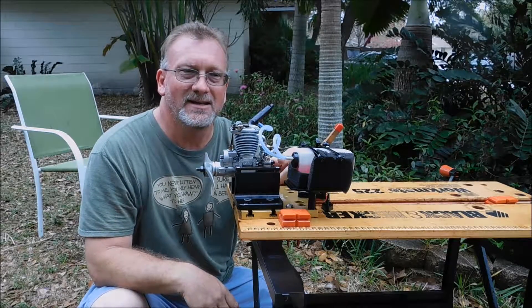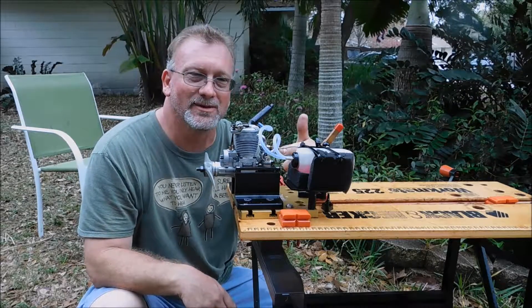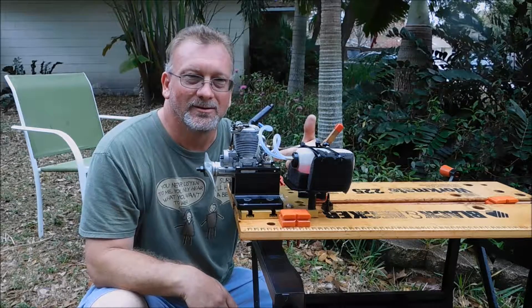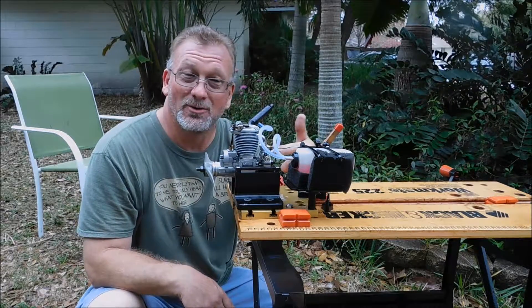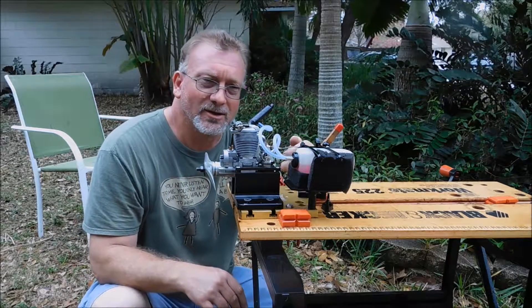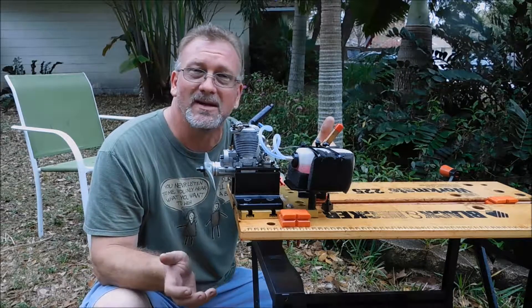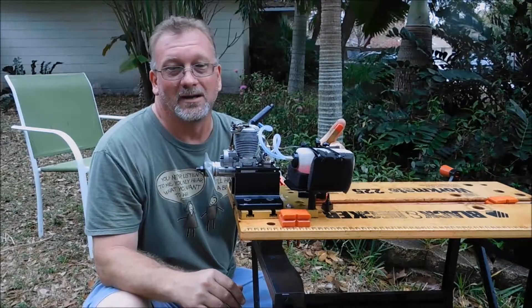It was interesting because I didn't even need to adjust the needle valve at all. On the last run I had the needle valve set fairly rich because I had backed it out to richen it up, and this time it was almost peaked right where it was, which was kind of odd. In fact, when I started to lean it out just a hair is when it started to drop down. So it was almost already peaked. I think that was a pretty cool experiment, and I love this engine.